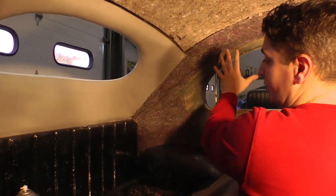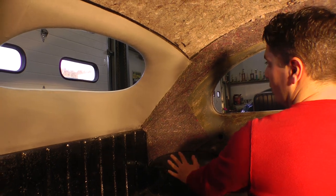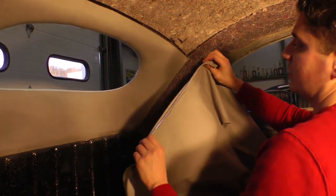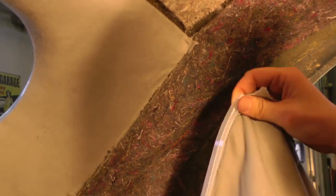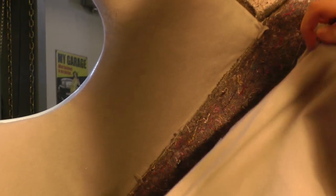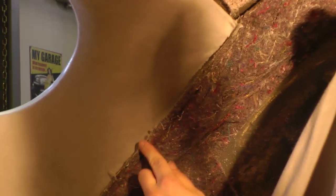The next step is behind the rear quarter window. This gets glued down to the wheel hump, and the plastic strips on this material have to get tucked behind these grippers. Just tuck this strip back like that so you have a nice fold, then put the strip behind the grippers. Make sure you're even up and down and lined up. If your teeth are sticking out, you might want to hammer them even again.